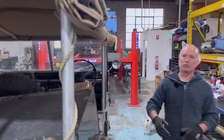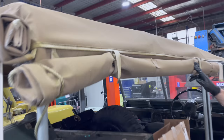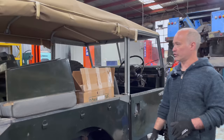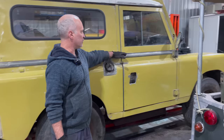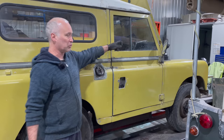Any modifications on this one that have been done down the years? Well, this has had a soft top. I don't know if that's original — that soft top looks to me like it might be new and added in. Yeah, it certainly does. And that's a popular modification. Soft tops have a long history with Land Rover, but they didn't always come from the dealer with soft tops. Most of them actually came as hard tops. But one of the lovely things about Land Rovers is that convertibility — you can turn a hard top into a soft top. You can even remove the whole hard top here. And you can remove the door top — it's just two bolts, two nuts, and the door top lifts out if it isn't rusted in.